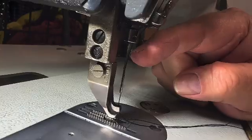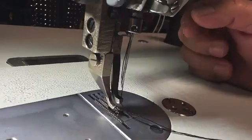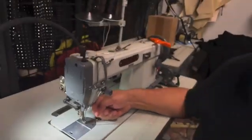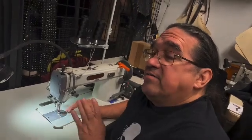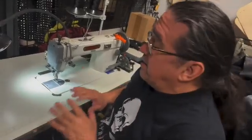Most systems have the long groove on the left and the scarf on the right, but there are some machines like the overlocks and my Conso zigzag machine where the needle, the long groove, must face the front. You put it in like a conventional machine and guess what? It's not going to work. So the fine details of your machine will be unique to yours, but that's easy because once you log it in your logbook, you're not going to have any problems.